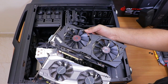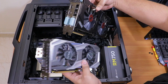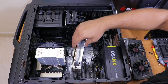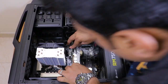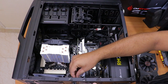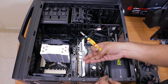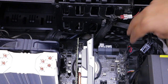Here you can see both graphics cards — on the right is the ASUS GTX 970, which is quite bulky and large, and on the left is the new GALAX GTX 1060, which is lighter and smaller. I'll fit it into the PCIe slot and screw it in. Make sure to tighten both screws since it occupies two slots, otherwise it will be loose and may damage the card.